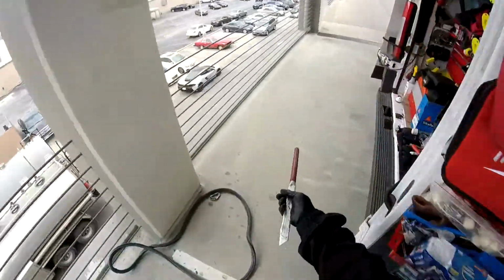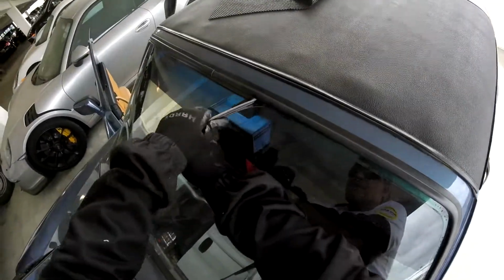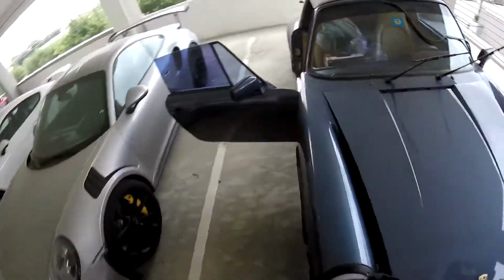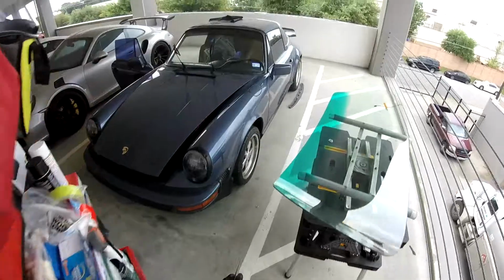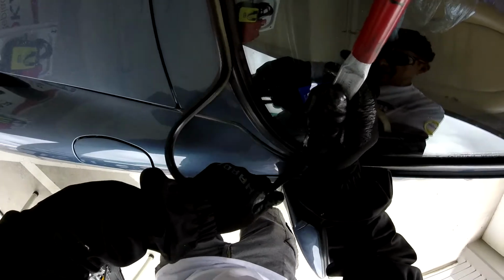You see the seal? That's where they put the seal, this one. You can see the glue between the gasket. That's why we have to do the same one. This one doesn't have too much, but you see the glue. It's not urethane, it's like a silicone, a little more soft. All right, that one is properly ready. So my goal is not to make too much damage on the lock strip, this one, because it's the middle. But that's the problem, sometimes it's easier to damage that one.